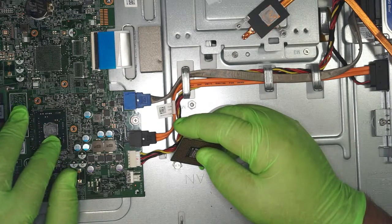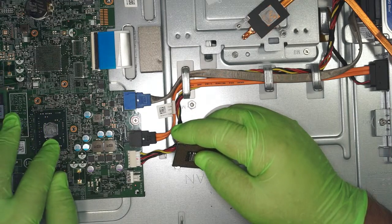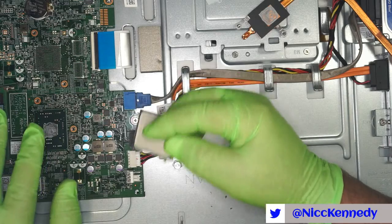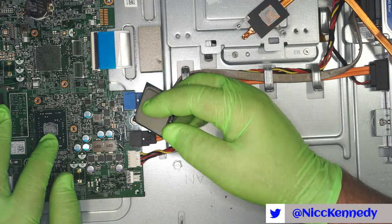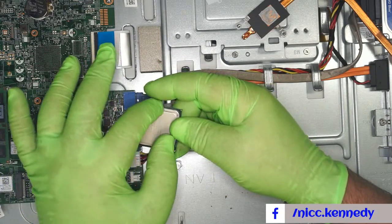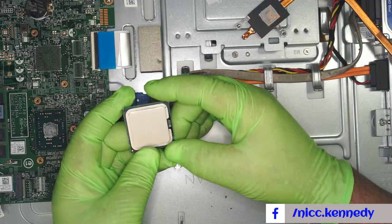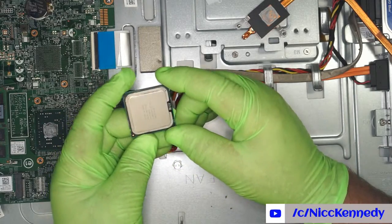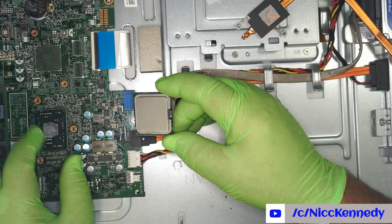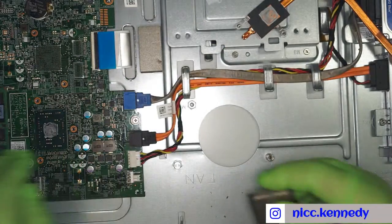This type of CPU, where there's no lid, no heat spreader, and you're just looking at the die, you can't have as much pressure because you can crack those, but you do want to put more thermal compound on than you would for one of these. You want more because you need to get the whole thing covered instead of having it smash out. Generally, these are soldered around the edge, I believe. I've never delidded a CPU myself, but if not to the die, they're soldered somewhere, and it's a nightmare to get them off. Anyhow, there's that quick little thing.